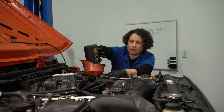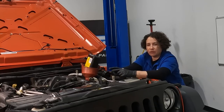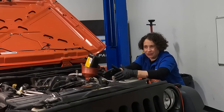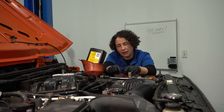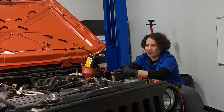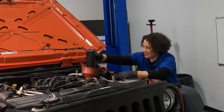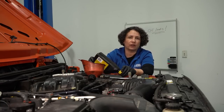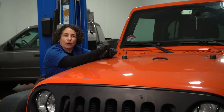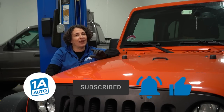We're going to put our last quart in. I've already done the coolant. I'll run it without the engine cover so I can get a good visual of everything. It's going to smoke because of how much oil was there. Once it's running and reaches temperature and I'm happy with it in the bay, I'll drive it to a car wash and do the undercarriage to get rid of all that mess. I don't recommend spraying with parts cleaner because if you get that into the O2 sensor, you'll probably end up with an O2 code — those sensors don't like parts cleaner. So just let the car wash do its thing. Well, that does it — we've fixed the leaks, going for a road test and through the car wash. Don't forget to subscribe and ring the bell for notifications so you won't miss future videos.